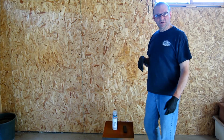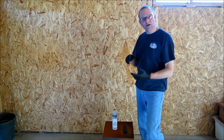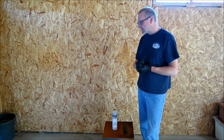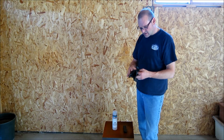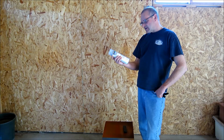Includes this portion of plastic. About all I have for plastic. So, wash it with warm water and mild detergent, mild soap, just to get the release agent off. And scuff it. If you have any print, like I had some white print from their factory, which I didn't want on there, I just used my Scotch pad and took that off. Just scuffed it right off, came right off. And then followed up with a cleaning solution, and then with the tack rag, and then plastic primer. Not too exciting, but thought I'd share that just for the heck of it.